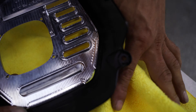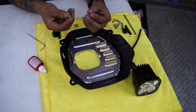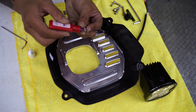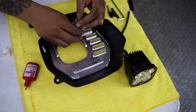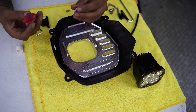I took the hood off and I'm going to show you guys how to install it. Now that the hood is in place we have four screws — two small ones and two long ones. Make sure that the two short ones go to the bottom. Dab a little bit of thread lock onto the screw itself. Screw them all loosely at first and then finally tighten them in a cross pattern.